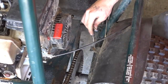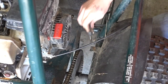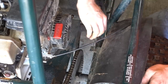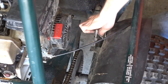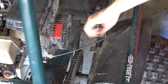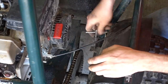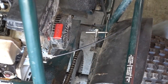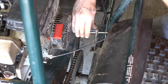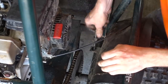I think originally they had like a quarter inch bolt go through here, and then you'd put a nut on the back side, but I'm gonna tap it 5/16 so that way you're not chasing a nut. Hopefully it works. Maybe it's already tapped to that. Nope. But that piece is relatively thick. And all it does is hang onto this piece of plastic here. Got some cutting oil right in reach. Might as well use it. That nut's got to be tightened up too.